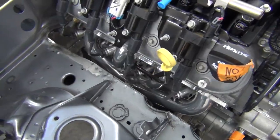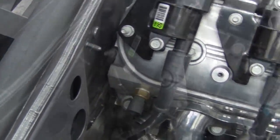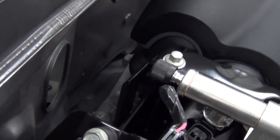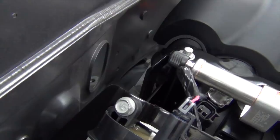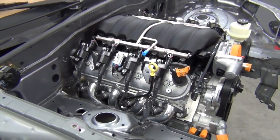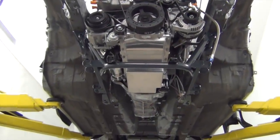The passenger side cylinder head is the tightest area, but the camera is a little deceiving, as there is a good amount of room back here. We've also got the proper clearance at the top of our bell housing, where we had to make a little notch in the firewall. Everything's looking pretty good under here.